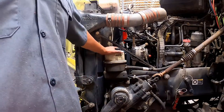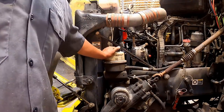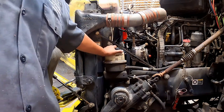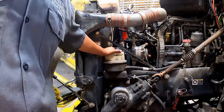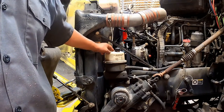Power steering fluid: same as the coolant fluid, you should indicate where the power steering fluid dipstick is. If the reservoir has a side glass, you should be able to locate it. Check the power steering fluid level — the level must be above the refill mark.